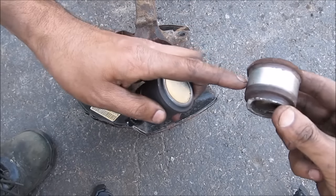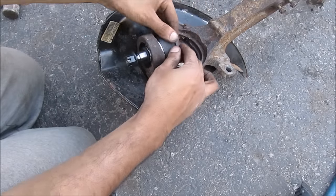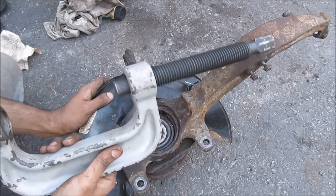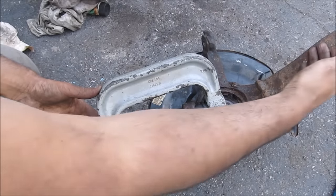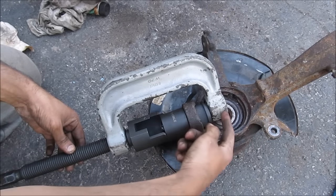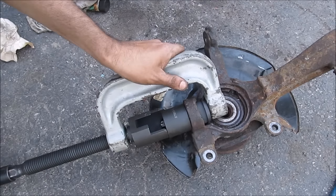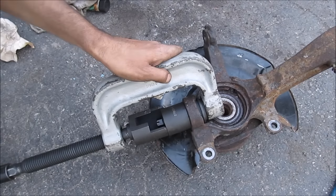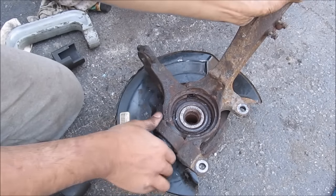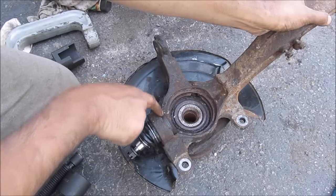One thing you'll notice is that the OEM ball joint doesn't have a knurling on it, but the new ball joint does. On some of these ball joints you might have to remove the boot if it's bigger than the knurling. I'm just going to place this in here and give it a light tap with the hammer. I'm finding the C-clamp a bit annoying because it can't go on this side without crashing into the knuckle, so I've set it up with two adapters on the bottom to press it in from the other direction. The ball joint is now seated — the knurling made it all the way through and the backing plate is now flush with the top of the knuckle.